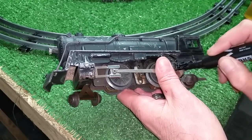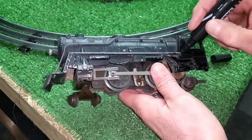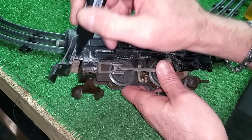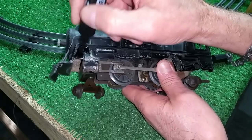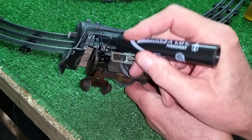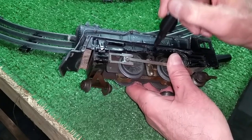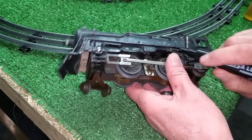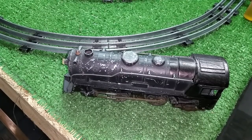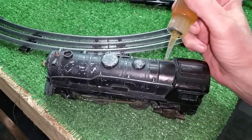It's pretty straightforward — just touch up the spot where the paint is missing. It won't hide dents or anything like that, but it replaces the missing paint really quickly. You can do this entire thing in about 10 minutes. This is a real great expedient, because the only alternative is to tear this thing apart and repaint it. You can see the marker has dried and it's now dull looking, but it does not match. Now watch this — motor oil. Put one drop of motor oil on this.